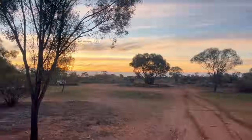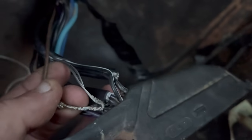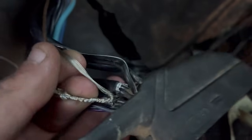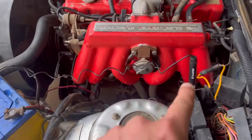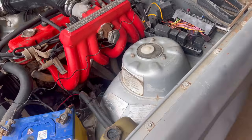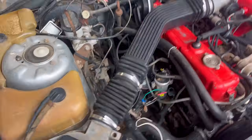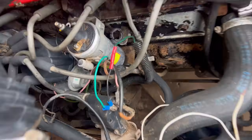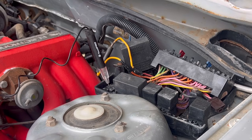Cue my introduction to 80s fuel injection. That previous clip was morning. It is now late afternoon. But this was just the first of many long days chasing electrical problems. So I'm trying to get power to this guy. He runs off of negative on the coil and it's an ignition supply. I could not find anything to make this work. And then I found this wire. So like I said, he goes to the negative on the coil